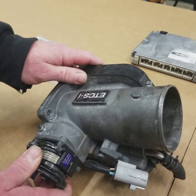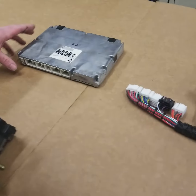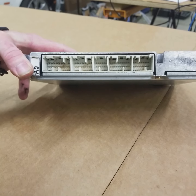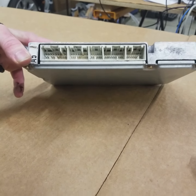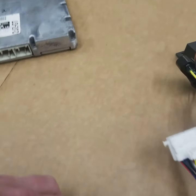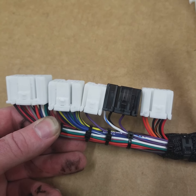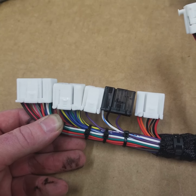You cannot remove the drive-by-wire system if you're running a factory ECU. All the factory ECUs that use drive-by-wire are going to look pretty much like this — this one happens to be a 2JZ VVTi ECU. The 1JZ ETCSI will look pretty much the same, a couple small differences but the basic layout is the same. We went ahead and pulled out a Pro Series 2JZ VVTi harness so you can take a look at what it looks like. The connectors are going to be the same for the ETCSI, with just small differences between the turbo setups.